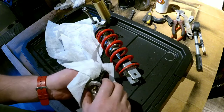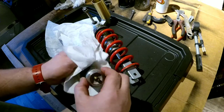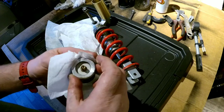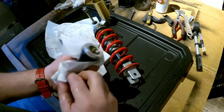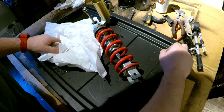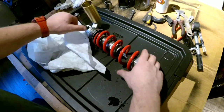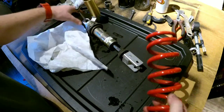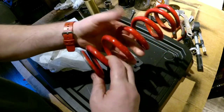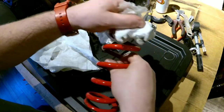Okay, interesting, I thought we were going to see a piston in the reservoir, but we got the bladder. That's even better, a lot less headache. A piston has to be adjusted into a certain position before assembly, and with a bladder we're not going to have those problems.